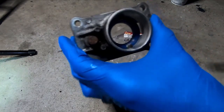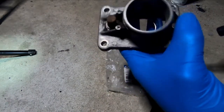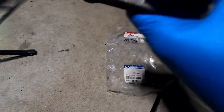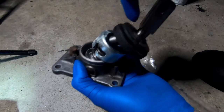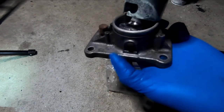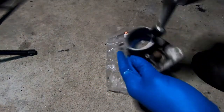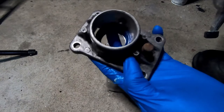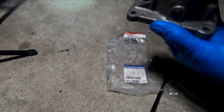In case you forget which side is front and which is back: this little tab points toward the engine bay, and the manufacturer number or letter faces you. You want the shifter leaning toward you since that's where you'll be shifting. If you put it the wrong way and try to install it, the housing will not sit correctly with the transmission, so make sure you have it oriented correctly and you can't go wrong.